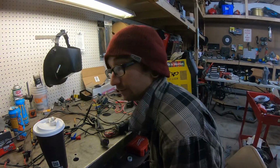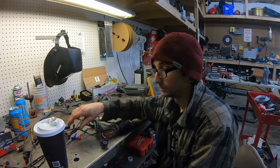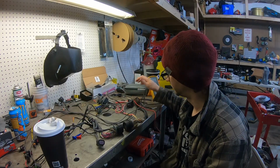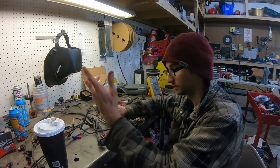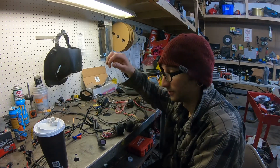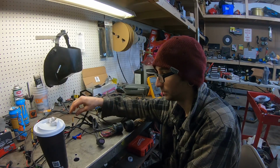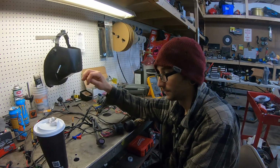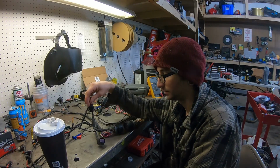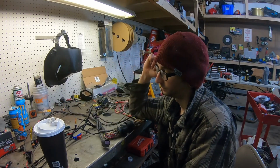And what I'm basically doing right now is going through, checking continuity on everything. So from the connectors to the PCM connector, like from the injector connector, for example, to where that pin is on the PCM, checking all that stuff out. So far, injectors are all good, coils are all good, crank sensor's good, map sensor's good, cam position sensor wasn't reading right, throttle body is not reading right. I think there was one wire in the coils that was not right either.